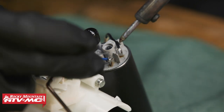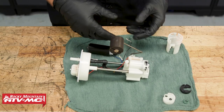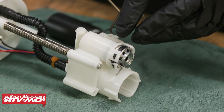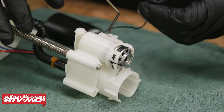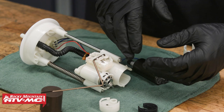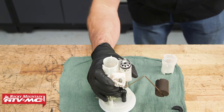I'm going to add just a little bit of extra solder and heat this up to put the wire in place. Now that we have the black connected, we'll remove the blue one and replace the original wire back in place. This piece here is our fuel pressure regulator. On some other models, like some of the Rangers, it's going to be further up. It might just have a clip you take out or it's going to have tabs like ours. Depending on which machine you have, the rebuild kit will tell you to run the original one or replace it. On ours, we're going to replace it. We remove it the same way we removed the fuel pump cover — we just need to loosen up all four tabs and pull it out. It can be kind of difficult, and it's going to help if you have another person there to help you.